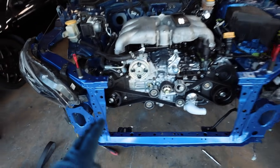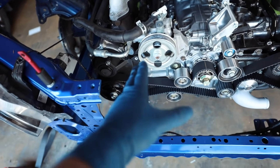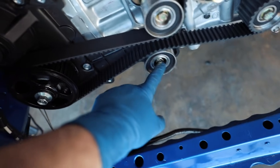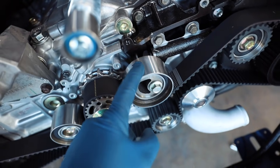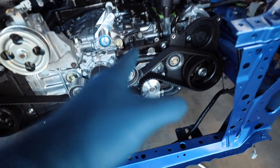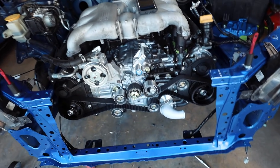I lined up the yellow marks - the ones for the cam gears are solid. I lined that up with the line on the cam gear and then with the timing cover. I think I was just half a tooth off when looking at it through these little holes up here. Put this last pulley on after you get everything set. The tensioner bolts up right here - we pull that pin and it pushes tension on this pulley, which then pushes tension down on the timing belt. As the pulley and belt wears over time, this will continue to keep pushing tension down because it's an adjustable pulley. We'll turn the motor over a couple times to make sure we're still in time, then get the pulleys re-torqued and permanently get our timing covers put back on.